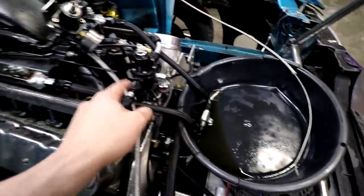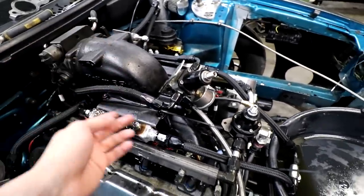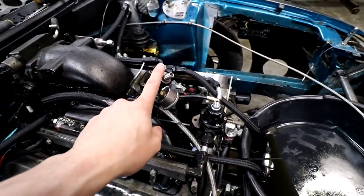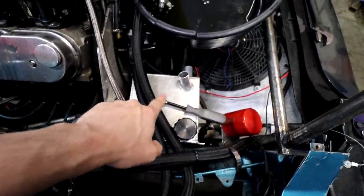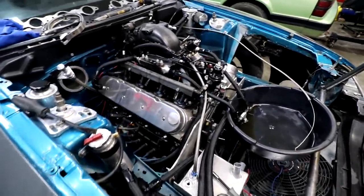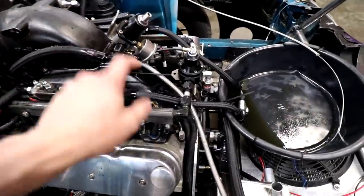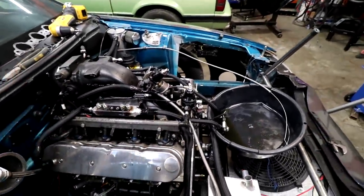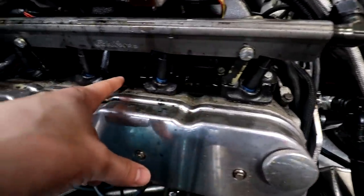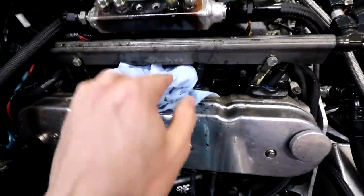Here you get a better look at our oiling system. The feed came in here, went through the two rails, fed through all eight ports, came out the backside of the rails into this fuel regulator where we could adjust it down to like 20 pounds, and then back into this tank. The tank went to the pump, the pump to the cooler — you get the gist of it. So all that's gonna come off now and make it look a ton cleaner, getting rid of these lines that were never meant to be there. There's oil pouring down here — these gaskets are just covered in oil now.